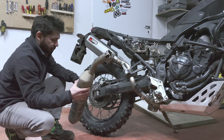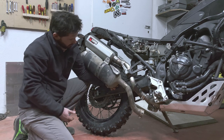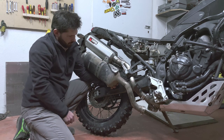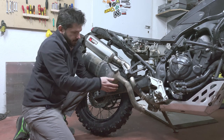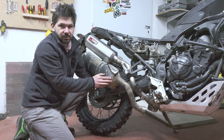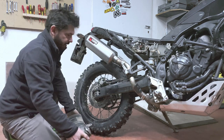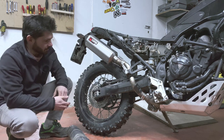It will bend inwards even if you drop it at zero speed. It's just unfortunate that Yamaha did it this way because the exhaust is about this high and there's a triangular mount which just mounts to the exhaust, and this bracket is really really weak on the side of the bike. So you're constantly hitting the exhaust here even if you just drop it in a parking lot. That bends it inwards, and then as the swing arm moves up and down it starts scraping the bike.